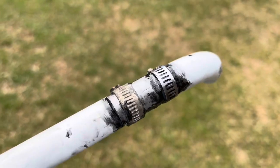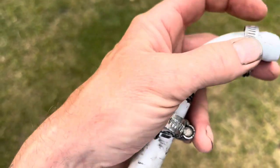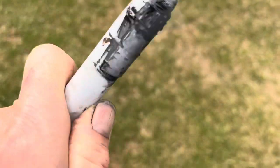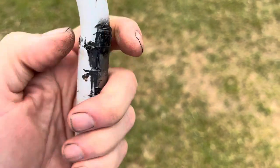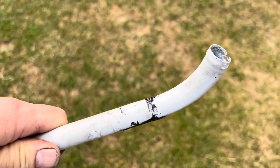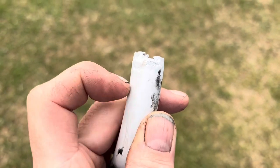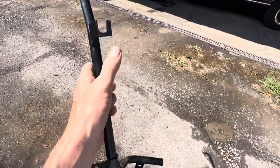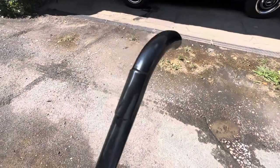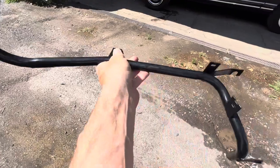The next day and the panel bond is dry. Amazingly enough, after undoing the screws, both of those hose clips came loose. We'll just give this a light sanding to tidy up the excess glue and then this will go back to the powder coaters — they'll reprime this section. That repair patch is underneath the pipe so you'll never see it. This little section up here isn't perfect but it will be covered by a pipe, so there won't be any leaks, and unfortunately this pipe is no longer available.